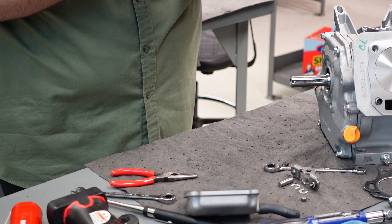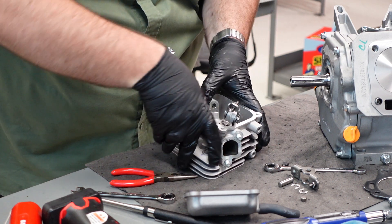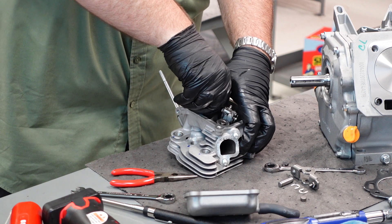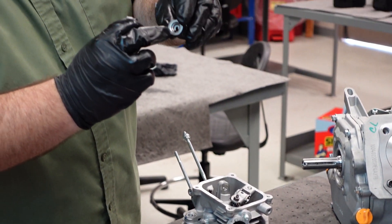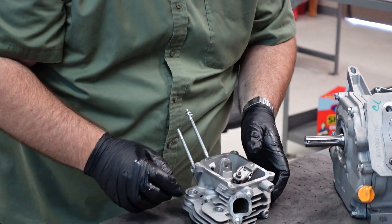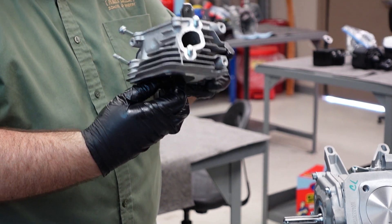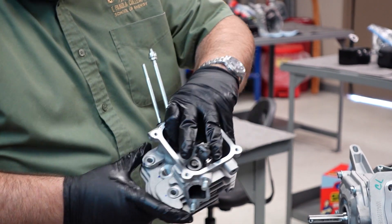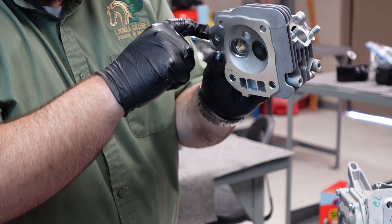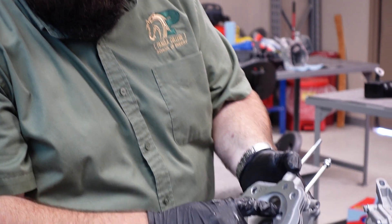The trick is when you push down, you don't want the valve to come down either, so sometimes you have to put something like this old cap underneath it to set it on so when you push down it doesn't give. I'm not pushing down very far — I'm rocking it to the side and then it comes off, like that. See the notch in there? It's lopsided, so you just take a little bit of spring tension off, push it, and it comes out — kind of like taking a picture off the wall. Now you can push your valve out. There's an oil-sealing rubber cap there that just keeps oil from splashing through that hole. There's your intake valve — that's where your gas and air would be flowing through from your carburetor.